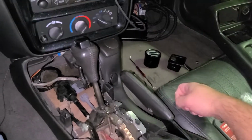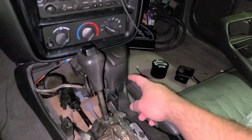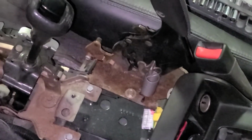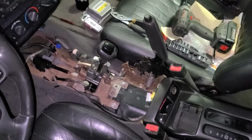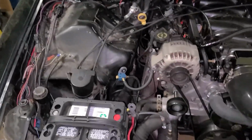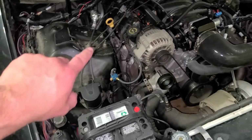But if it's really that big of a deal, I can put it on a button. So I just finished getting this all wired up. I got a little splice just connecting up to the wire that is actuated by the e-brake right there on the bottom. So it's a ground. And we got the boost controller set up. The wires are hooked up. Just imagine you can see those.